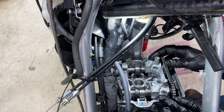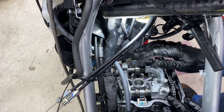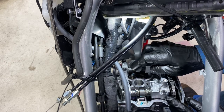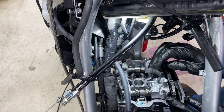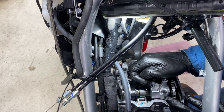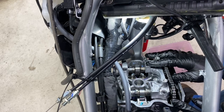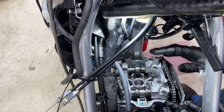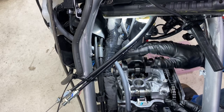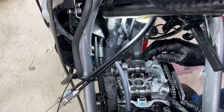Welcome back everyone. I'm doing the CBR cam swap and just before I unbolted everything, I measured the actual valve adjustment. We've got 0.27 on the exhaust which is in factory spec. We have 0.16 on the right hand side of the intake. We've got just under 0.13 on the left, so theoretically this is under factory spec. This is a six-kilometer-old bike — a brand new bike — so it's very surprising that the adjustment is already out, or maybe it wasn't done right at the factory. It just goes to show it's worth checking, because others may be out of spec as well.